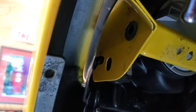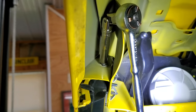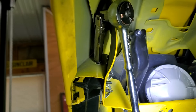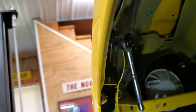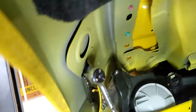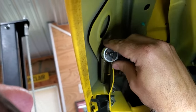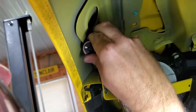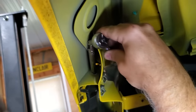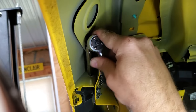We pulled the two bolts out from right here, but there's also one right above — it's a 7-millimeter. I'm trying to give you some light so you can see it better. You're going to need a quarter-inch set with a deep well and a swivel on it. Doug's going to show you — once you get that out we can do the corrective action on these ends of the bumper and get them back where they should be. It's tight, folks, I'm not going to kid you.